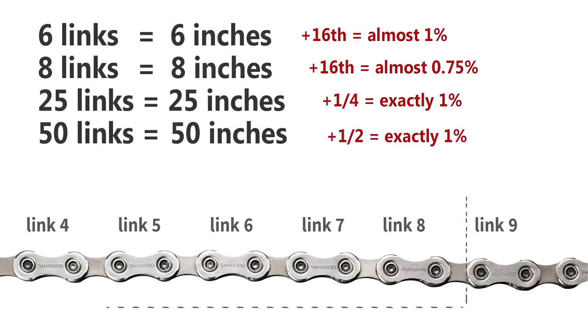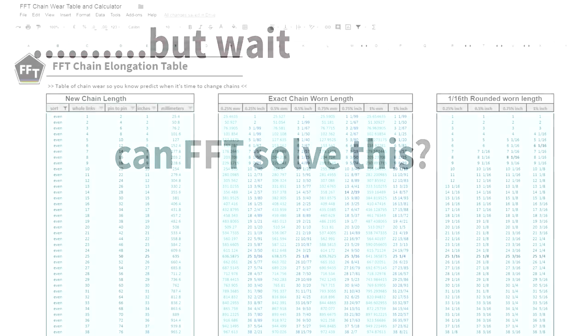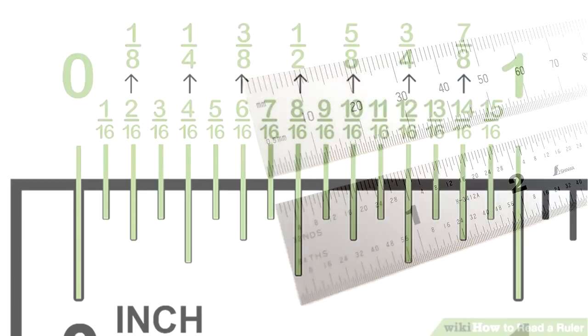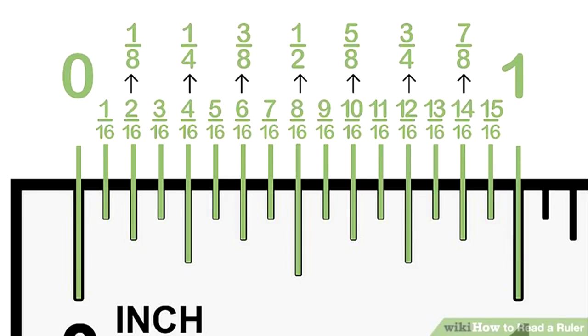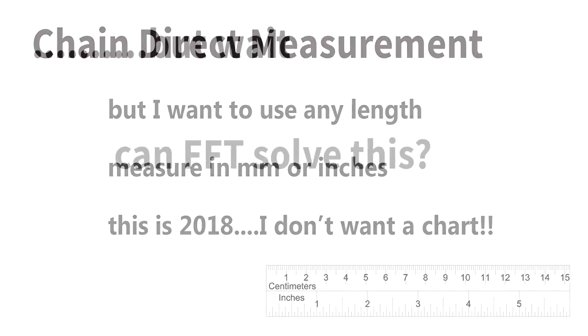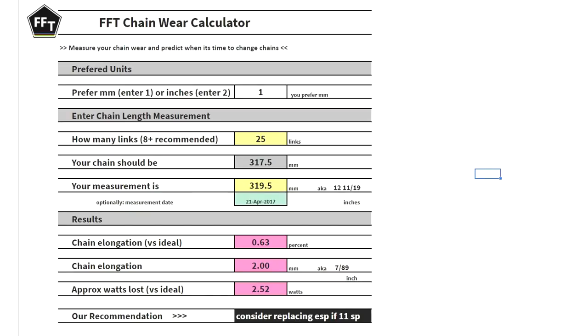But come on guys, we can do better than this. This is 2018 — can't we make a chart of any number of links measured with any decent amount of elongation? Let's say 0.25, 0.5, 0.75, and 1%. Of course we can. Here's the chart, which I'm going to put a link to below — the number of links in the chain and the elongation. I've even rounded to 16ths, in case your ruler shows those annoying 16ths rather than 10ths. So we can use this chart, but wait — I said this is 2018. We're not in the 1980s chart territory here. I don't want to use a chart. I want to measure in either millimetres or inches, and I want to use any precise length.